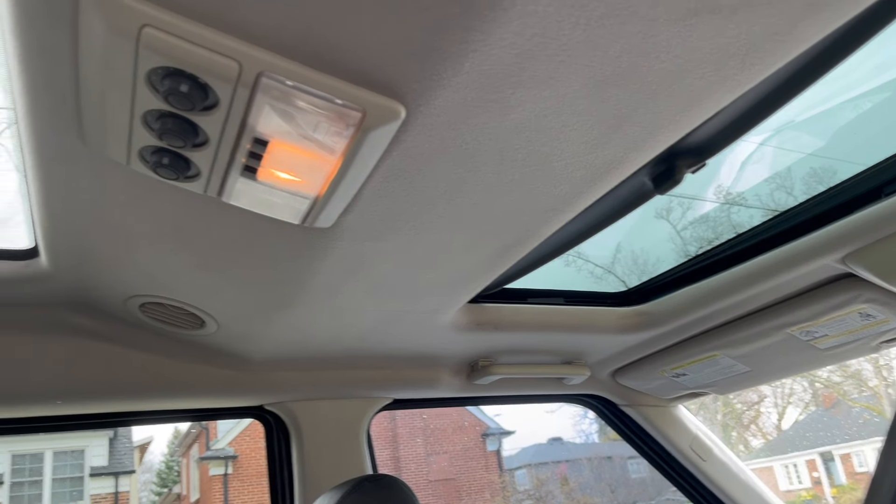I can't even get it to 150 - the breaker bar is bending. I'd say that's a job done. I couldn't find anyone else on YouTube who has done this job or documented it. People on forums have talked about it, but a word of advice to prevent this from happening: don't use the rear diff as a jacking point - use the frame.